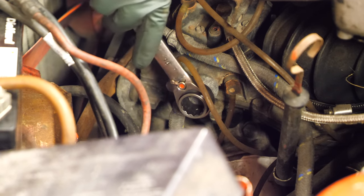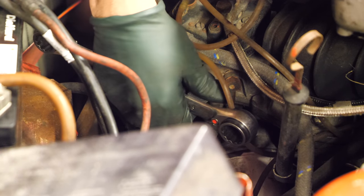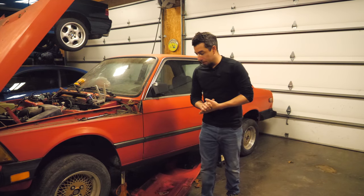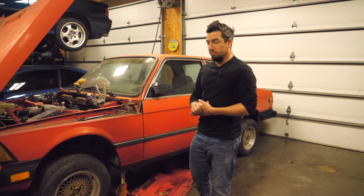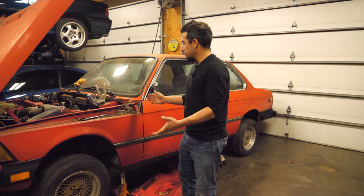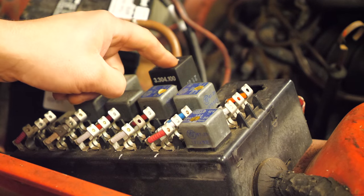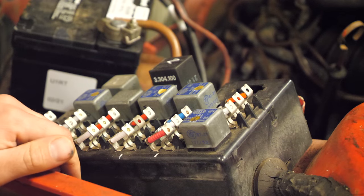Let's see if we can get some fuel out of this thing. No fuel — the fuel pump died again. We're going to try to zap it back into life. We'll see how many times we can do this. Eventually it's not going to come back, but I have ordered a new pump. The first time I got this pump working I held two wires to both terminals, positive and ground, then hit the pump body with a hammer. But that was very difficult with only two hands. So we're going to pull the relay off, bypass the relay key on — which should throw 12 volts back at the pump — and I can use only one hand and hopefully bring this thing back.